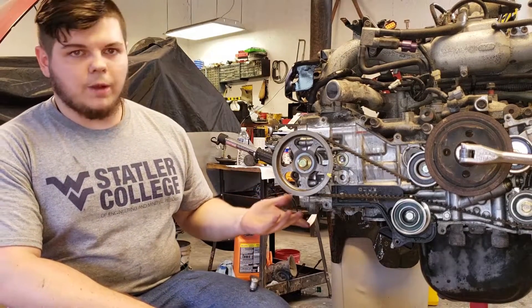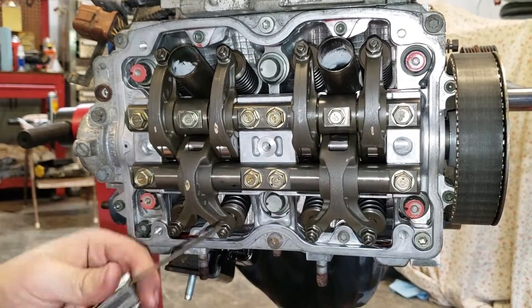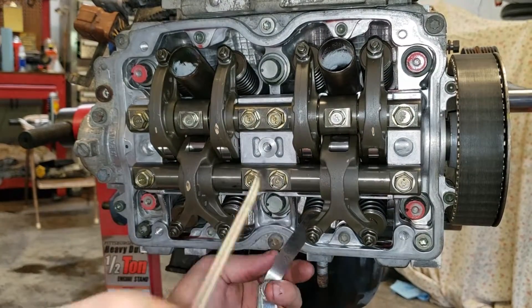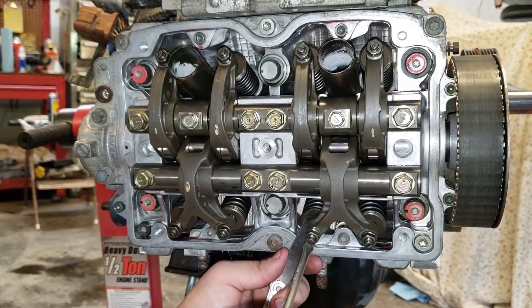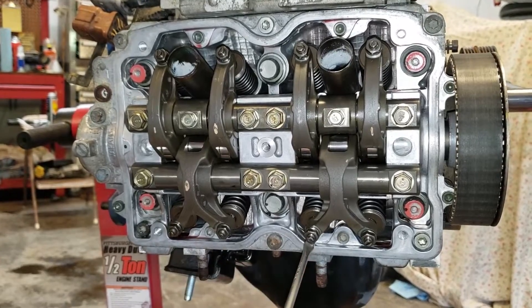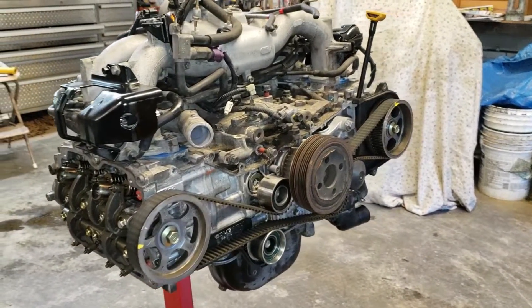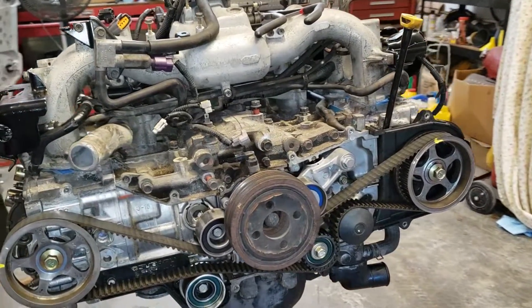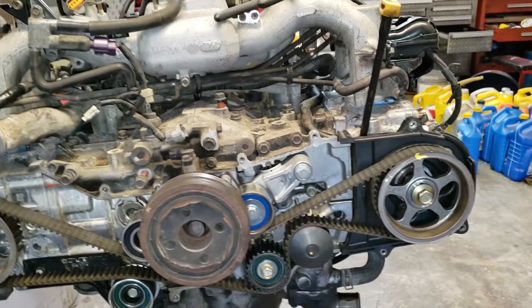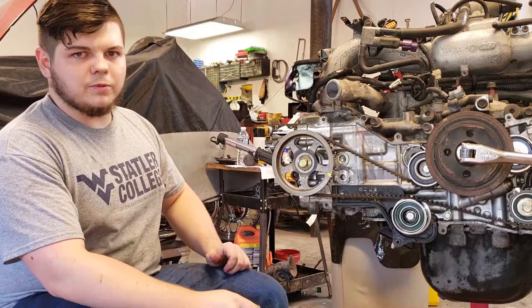As you can tell, it's really not that hard of a job as long as you have the feeler gauges and room to get to it. All you do is try the smallest size, see if it fits, then try the largest size — if it doesn't fit the largest, you're good and don't need to adjust. Even if you do have to adjust, it's not that hard unless you don't have room, which can be tricky in some Subaru engine bays. It is worth it because you get better fuel economy and often better power when your clearances are set correctly.